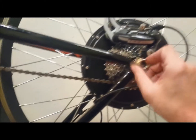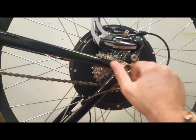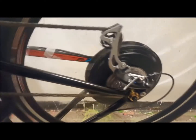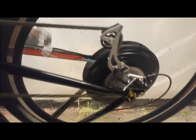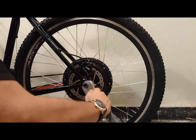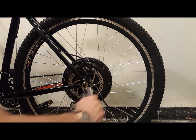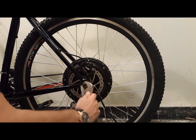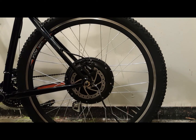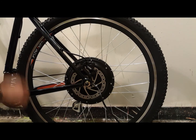Once I have firmly tightened the nut by hand, getting it as tight as you can by hand, I want to test if the wheel is spinning freely and true and that the movement of the chain on the cassette is aligned. I don't want any strange movement there because I need to ensure good shifting. Once I've done that, I firmly tighten both nuts with a wrench — not too tight, you don't want to break the frame, but tight enough because these are powerful motors and you want to make sure they're really lodged on there.